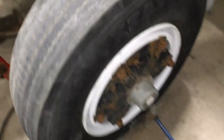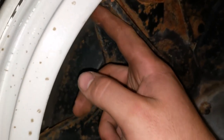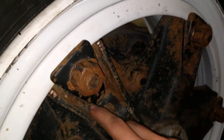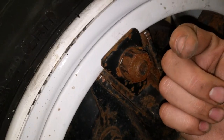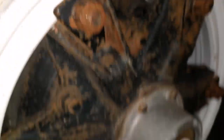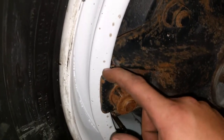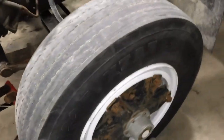The biggest thing I can't stress enough is when you take the lug nuts off, you loosen them but you keep them on the threads — because this little piece here is basically a ramp inside there. When this wheel goes on it kind of rides up the ramp and this little triangle piece just holds the rim onto this piece here. So when you loosen this off, there's a lot of tension and the rim wants to come off. There's been known times where people ripped this off while the wheel's under pressure, they give it a hit with a hammer and these little triangles fly right off and hit people, causing a lot of injuries. So you want to loosen all of them off but not take them right off the lugs. Then feel each one, make sure it's loose. You can wiggle it — it'll be fine. Then you can take all of them off and literally just kick the rim or pull it off. It's that easy.